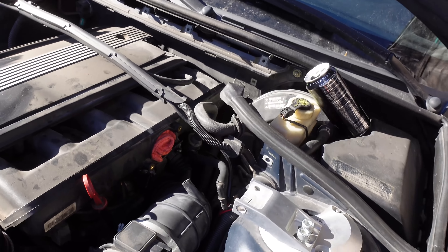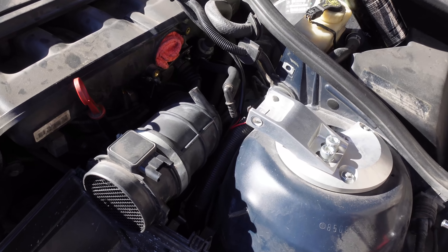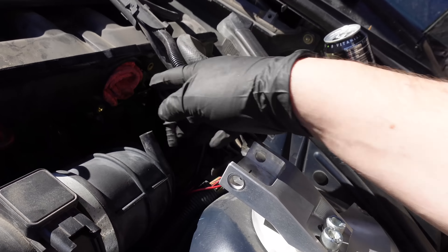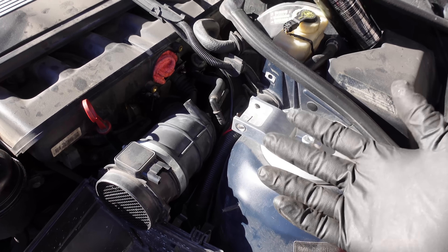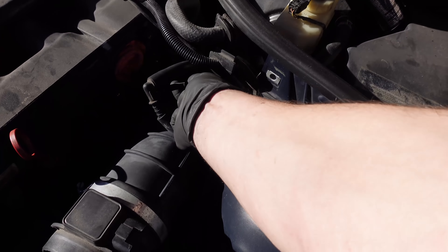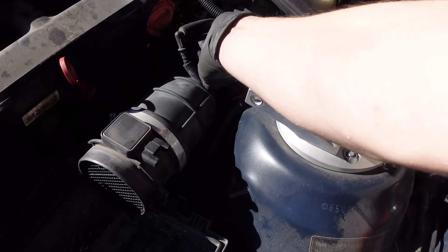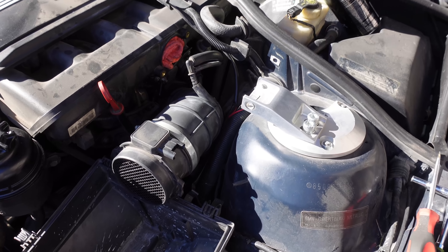Put the DISA back. Once I put the DISA back and hook the F connector back up, the car should be able to start. The F connector lines — these aren't vacuum lines. These are atmospheric references for the fuel pressure regulator. It would have been better if this filtered reference was before the MAF so that if any of this is leaking it's not a big deal, but nope, it's behind the MAF. This little one goes down to the fuel filter and regulator assembly, which is under the driver's seat area of the floor, and those go bad all the time — that's another common source of vacuum leaks. When I pulled on this a few months ago, it just came right out of the car because it had disintegrated on the side that's on the ground.